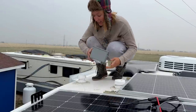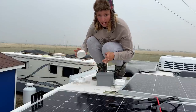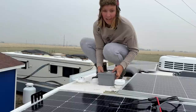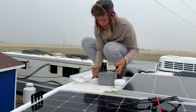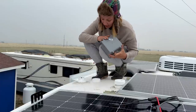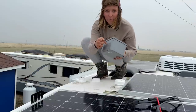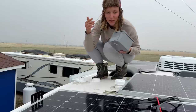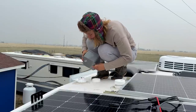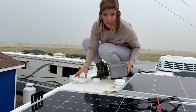The other thing we're figuring out: Brinkley put conduit on the roof so you can easily run your wires down, which is fantastic. But you can't just run wires down and leave a hole in the roof for water to get in. Since we're going to have three sets of wires — six total — we needed something that all the wires could go in and keep everything waterproof. So Craig picked up this box. I'm going to drill a hole here that fits over this entire thing, seal up all the edges, and drill little holes in the sides where cable glands screw on — waterproof fittings the cables run through. This way we don't have to drill any really big holes in the roof because they already did that with the conduit.